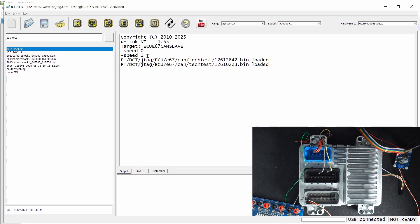Let's power on the ECU. It takes about 10 seconds, then you can start programming — you should not do it immediately or it will fail. Let's wait a little bit longer. Now, only one button is allowed for this operation. This one button will negotiate, talk to the ECU, and put it into the proper mode, as well as immediately program both the slave OS and the system OS. If I press any other button, nothing will happen, but I'm going to press this button.